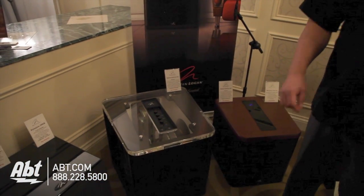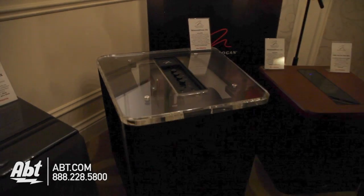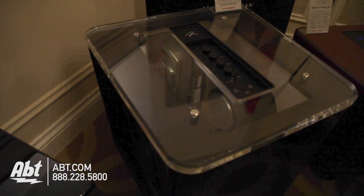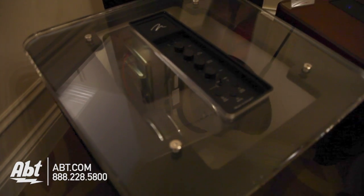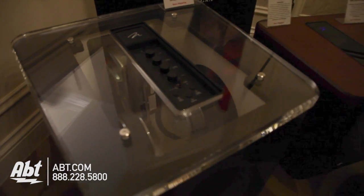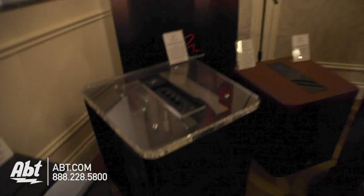Can you show us a little bit about the options? Well, there's a variety of unusual things going on. If you're familiar with the earlier Descent and Depth subwoofers, which many people did feel were the best in the world in many regards, we had used three drivers to cancel any cabinet vibration that would occur, because any time something is ringing, it becomes a speaker. The wood of a cabinet would ring and smear the sound, making many subs sound dark, muddy, dirty. By going to the driver arrays in the original Descent and Depth, we were able to use the vibrational energy from the drivers to cancel any vibration that would occur inside the cabinetry.